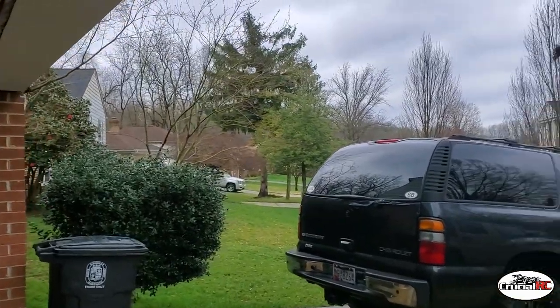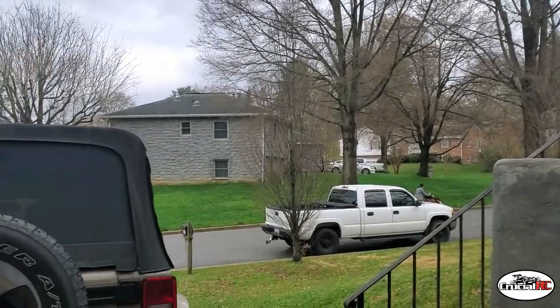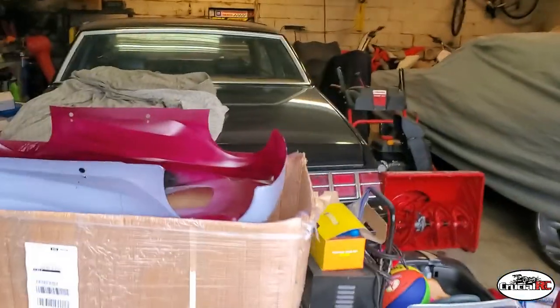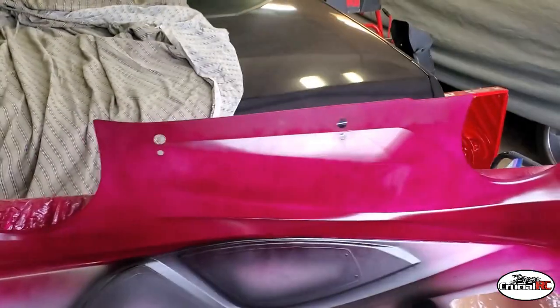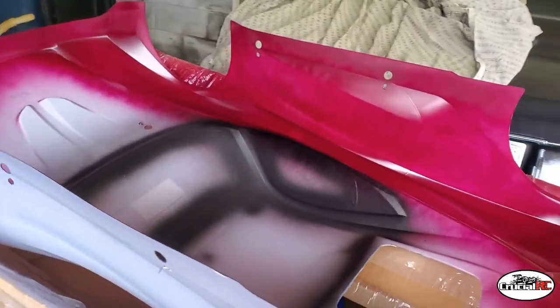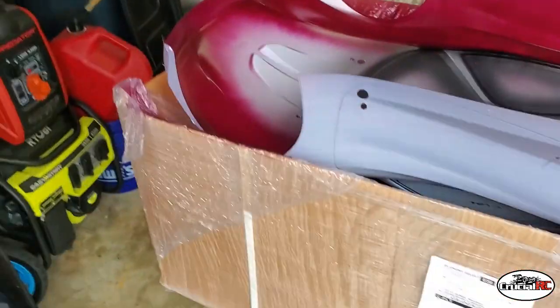Rainy day out, the sky is all gray and a little humid — actually a good day for painting. We laid down a couple coats of purple so far. It's going on pretty evenly; I'm hitting it with the heat gun between coats to speed up the process. I have about three coats of candy purple on here now — basically one can almost empty. I'm going to finish that can and do a second can before throwing the backer on.